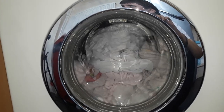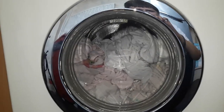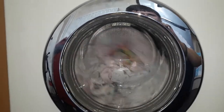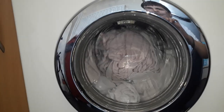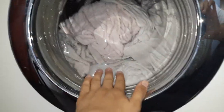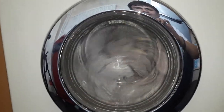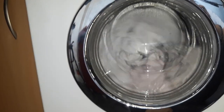I might throw that one out — that mildewy cigarette-stained one. Somewhere when I did the Valentine's Day wash in the A36, it was a pink towel that caused it. That was when it first started making that horrible screeching noise. It needed new brushes — but that was actually the motor bearings making that screeching sound. The brushes were causing an arcing sound.